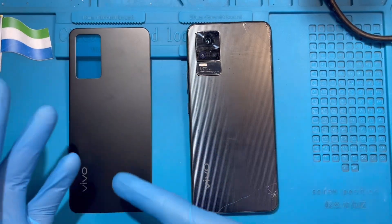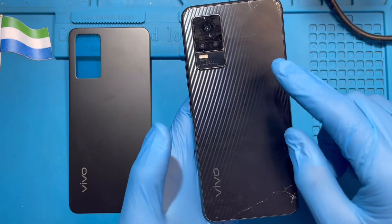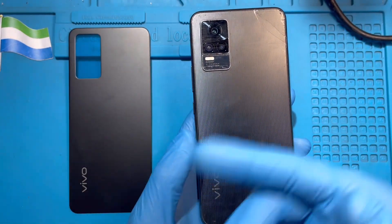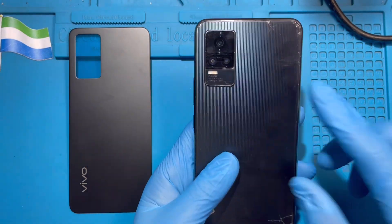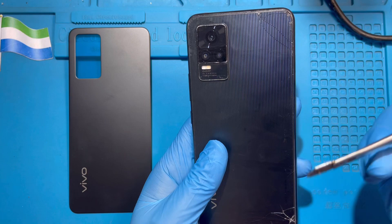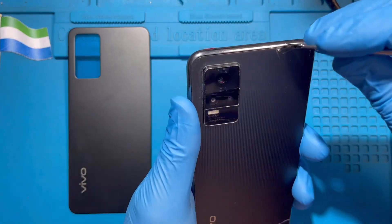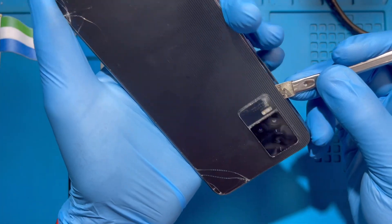Okay, this is the phone — you need to replace the back cover. The back cover is glass, and if you don't have a heater at home you can still open it and replace a new one. Even if this one is cracked, just remove it because you are going to replace it with another glass. If you use heat, it will make it easier and faster to open.